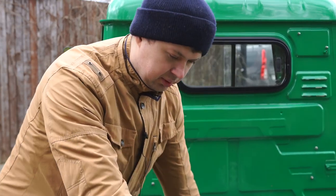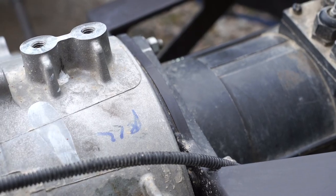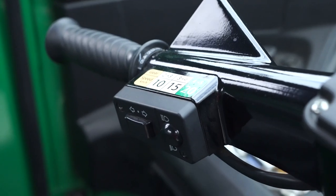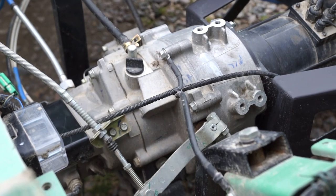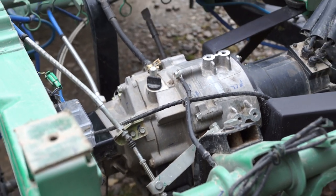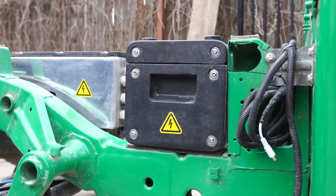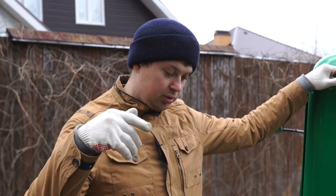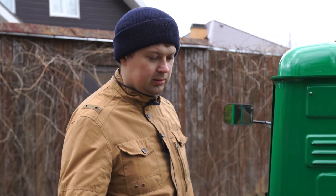Everything is combined with the original gearbox, and we have five forward and one reverse gear. There is an electric reverse gear which remains here, and there is still an option of a manual reverse gear. The vehicle remains mobile in both directions and has five options of moving forward. We drive mainly in gear 4 and 5, and we still have at least three lower gears — there is no hill that it would not go up.